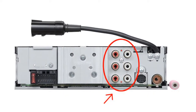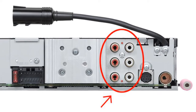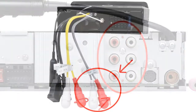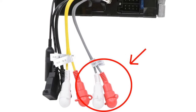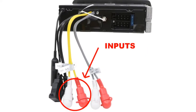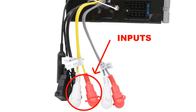The most common method is to use the RCA preamp output jacks on the back of the stereo. Some are embedded right in the chassis of the stereo like this. Others are on wires extending out from the stereo like this. You can identify them by the red and white color coding used to separate right and left stereo channels. Some stereos will also have RCA inputs, so be careful that you don't get them mixed up.